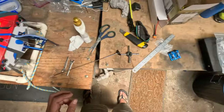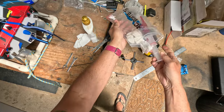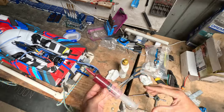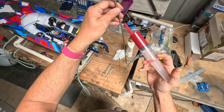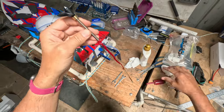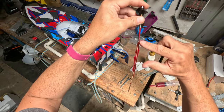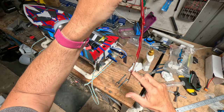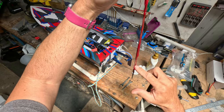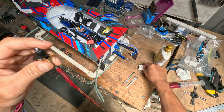They did give me some grease with the boat but I'm going to use my own for now. This grease is a little bit thicker than what they give you, so the thinner one is actually better — but it won't make much difference. If it were winter or somewhere really cold, you'd want to use the thinner grease. If you're stuck, you can use thicker grease and spray some WD-40 or CRC up there first, then put your cable in, and that thins it out.